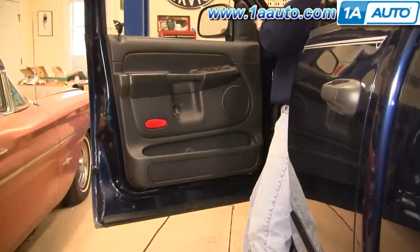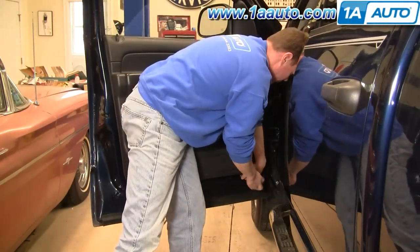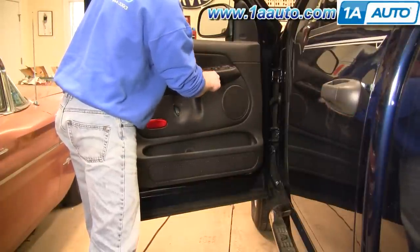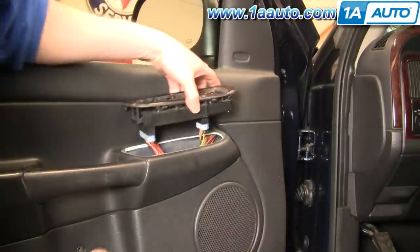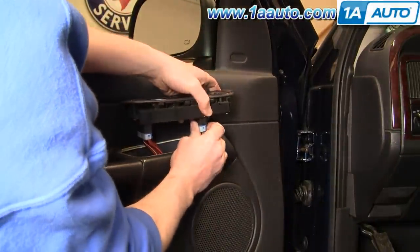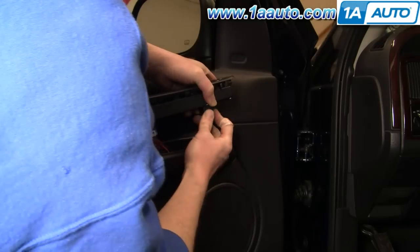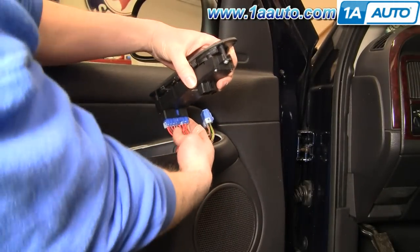Then I'm going to start with the Phillips screwdrivers, take those two off, and remove the two lower Phillips screws. Now use a regular screwdriver to carefully pry up on your switch plate here, then pull it up. Both these connectors have a little button right here — press the button and work the connector off the switch. Same thing here, button right there.